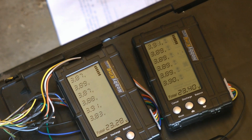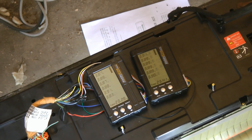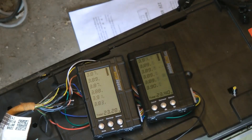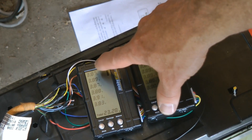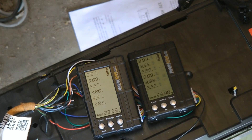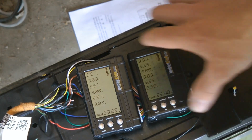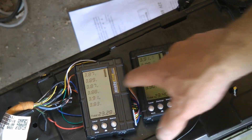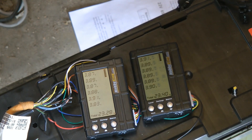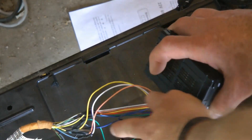I'm super excited to tell you that I figured it out. I got the Hobby King connected to the wires on top of the battery that run to each of the cells in a way that'll show me the voltages of each cell in the battery. The bigger chunks of batteries, the 48-volt ones, are made up of 12 separate cells, so this Hobby King battery medic is only set up to measure six, so I had to use two of them. I'm going to show you how to wire these into the factory harness.